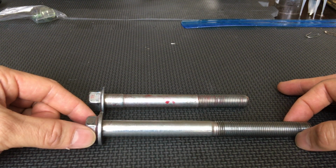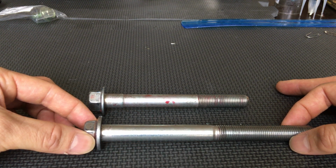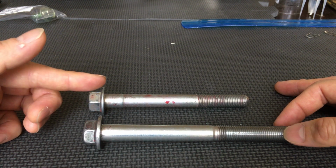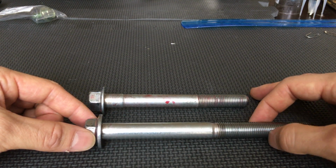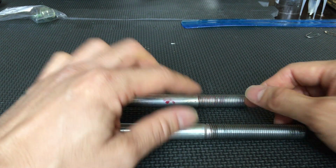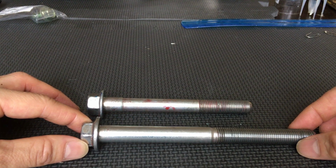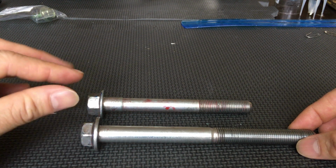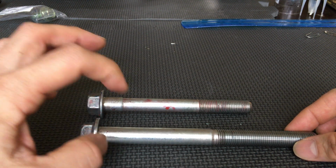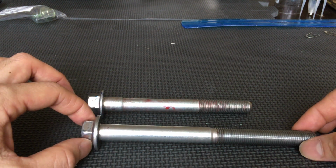It seems okay. I don't think it really negatively affected the performance. I actually felt a little bit happier when I had it installed. I actually looked into the bolt hole, and there's nothing that stops the bolt from going any further. It's just open space, basically, and the threading is about this wide, just based on my guesstimation. But I'm pretty sure having all 4 extended subframe bolts into the subframe is going to really lock it down a lot better, especially with the wider bolt and the wider and thicker flange.